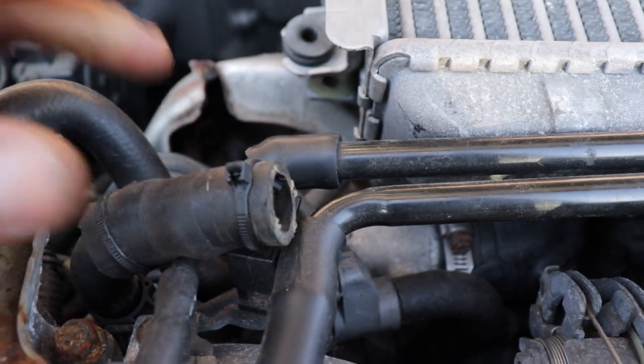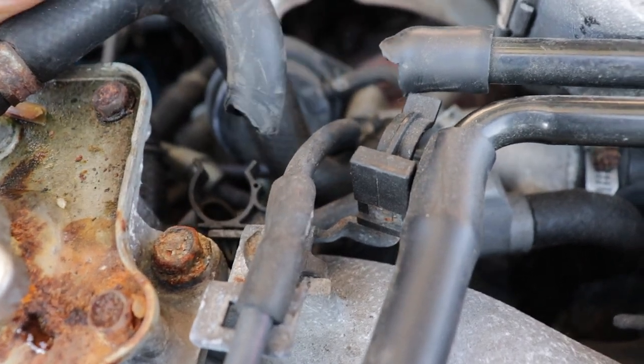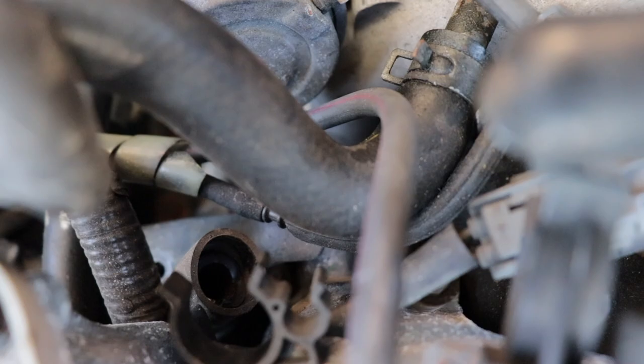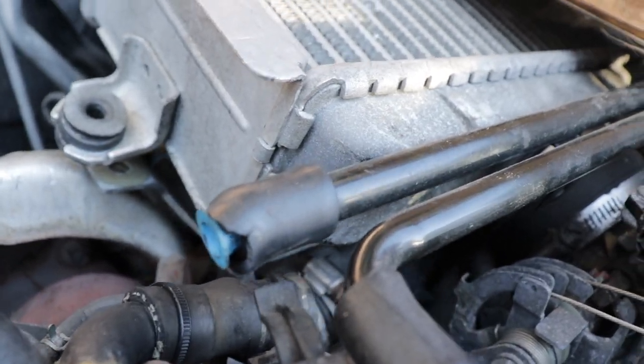Funny — I started playing with some of these hoses over here just looking around and noticed a little bit of corrosion. One of the PCV line hoses was actually zip tied in there together, and then I pulled up on it a little more and — oh boy — it broke right down in the hose. Not a huge deal if it's sealed, but if this is wide open that's a huge intake leak and it ain't gonna run right, if at all. So I'm gonna plug that and try to crank it. I'm really not expecting this thing to start but it's good practice — if you see something like that, at least try it because you never know.